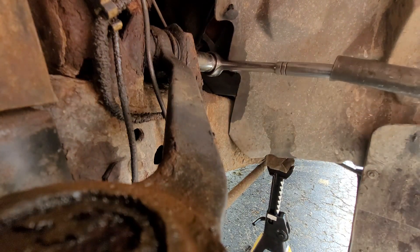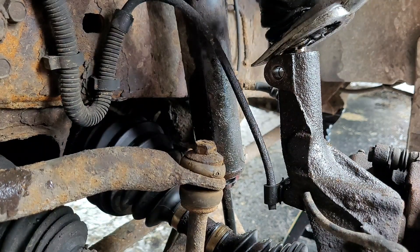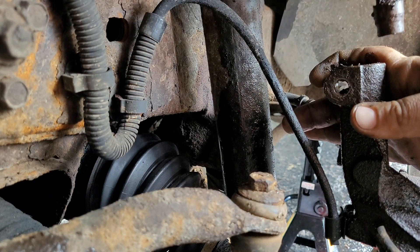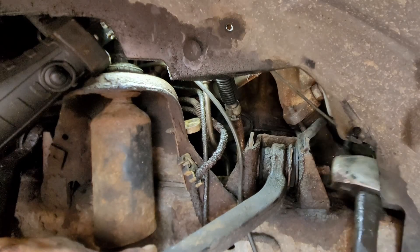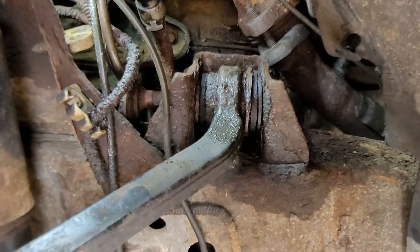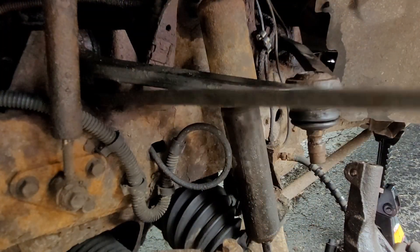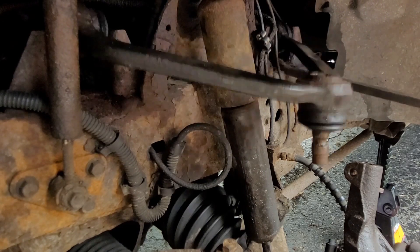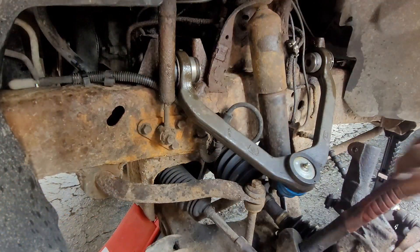Take a pickle fork, place it right under the upper ball joint, and hammer it in so you can separate it from the knuckle. Once you get it separated, go back up to the right side of the upper control arm — we need to remove the stud on both the right and left sides to remove the whole control arm. Take your hammer and hit the stud, then wiggle it out with your hand. There's not a lot of room up there. Once you do this on both sides, get your pry bar and pry on the left side up out of the grooves, then move to the right side the same way, and you can take the upper control arm right out.